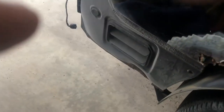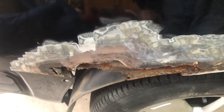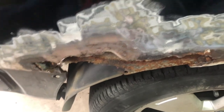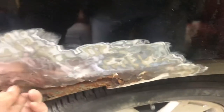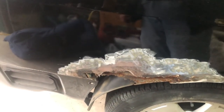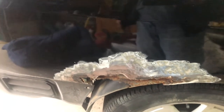It's not going to give me finished sheet metal — there's going to be filler. But what it's going to give me is a solid background, a solid backing to back the filler up, and we can treat it properly so it doesn't rust. That's why the rust is even worse here now — because they just slapped some foam in there, slapped some bondo in there, and called it good. That of course trapped a bunch of moisture and it just keeps rotting. You've got to get a hold on the rot and stop the rust, otherwise it's just going to continue to eat the car.